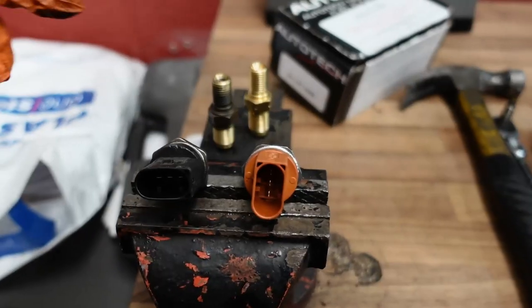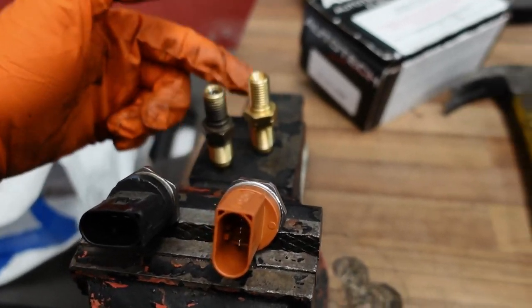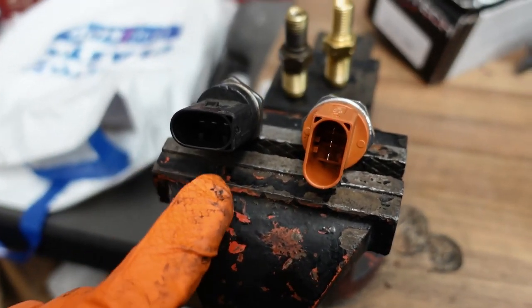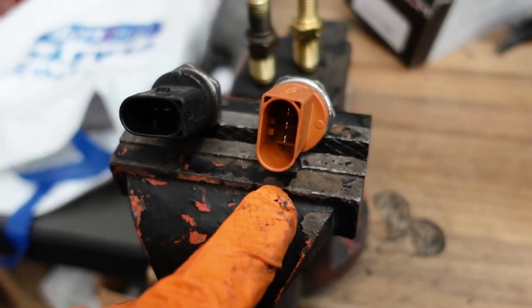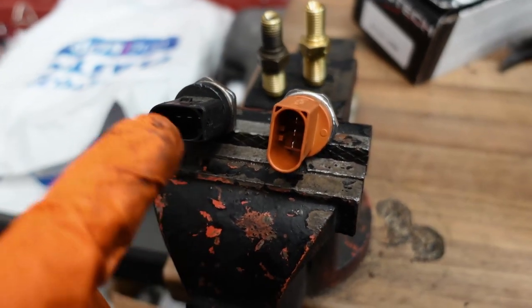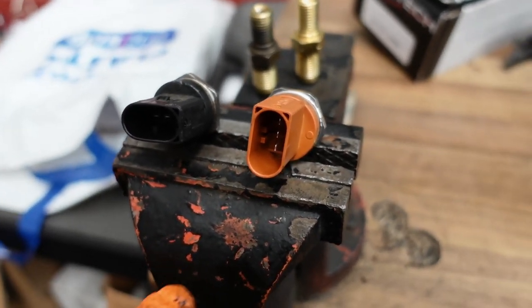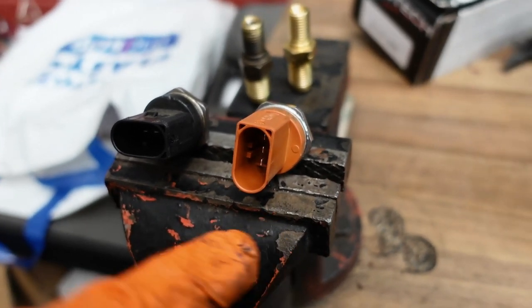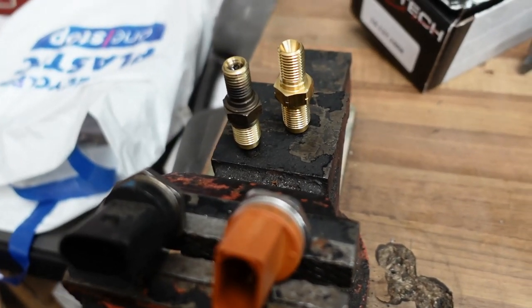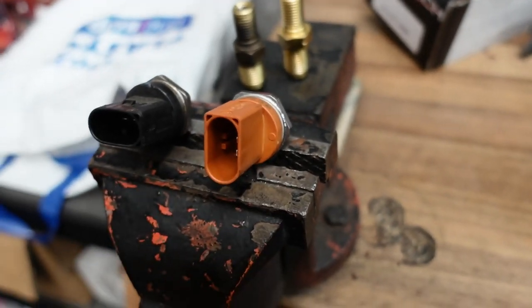Side by side they look very similar, but the RS4 fuel return valve — coming from the Audi RS4 — is about 140 bar before it cracks open and releases pressure, whereas the stock one is about 110 to 115 bar. The fuel rail sensor allows for 200 bar maximum, so we scale it appropriately in the ECU. If you run the stock sensor around 140 bar you lose resolution — you can't tell how much fuel pressure you're gaining or losing. It's always good to have a rail sensor rated higher than your FRV. On some models we can take it up to 175 bar cracking pressure on the stock injectors, but on this KO4 BWA setup we'll run the RS4 fuel return valve with the 200 bar sensor.